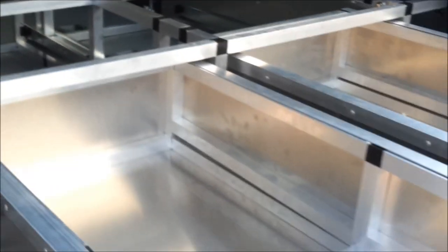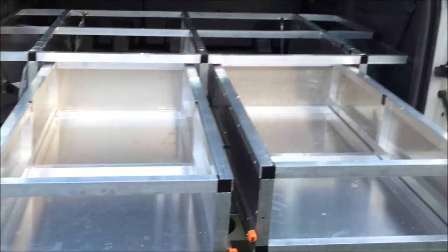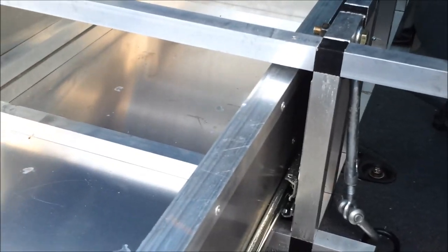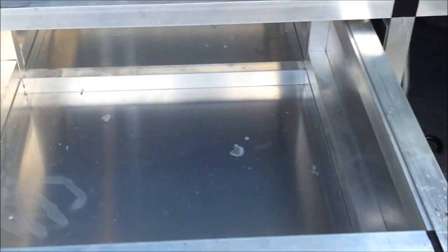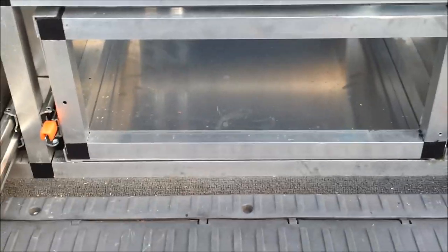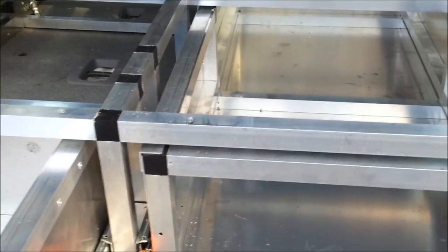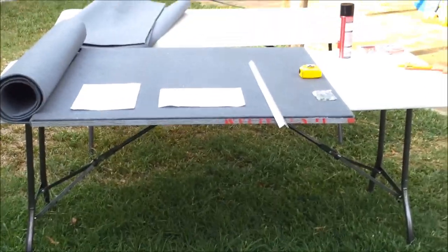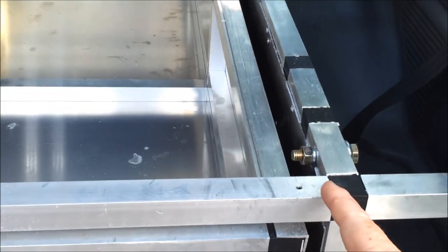Okay, so there are the drawers pulled out — I'll just move back a bit so you can see. I haven't put the carpet and the fronts on them yet. I thought it was more important to have the backs done first; they slide very easily in and out — it's a two-handed job. When they slide in they just lock in and they seem to work really well. I decided on 18mm ply for the top, which you can see on my workbench, and I've already carpeted the sheet that's going to go up there.